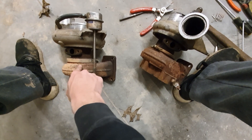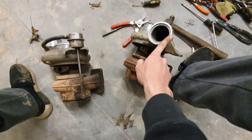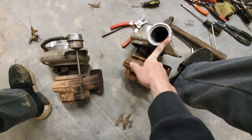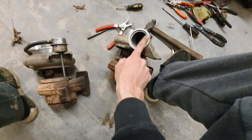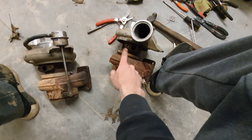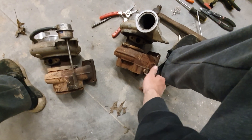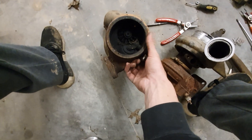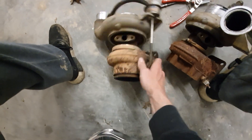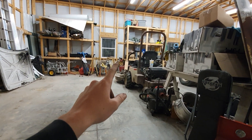Essentially, you could take this 9cm HE turbine housing with the angled gate and put it on the HY35, and it would bolt right up to your first-gen, second-gen, whatever. You'd have to do some intercooler piping work, but it'll bolt right up. The oil drains would probably be about the same, and you'd need a gate setup and a downpipe — because look at this thing, it's just massive and flows so much more air.